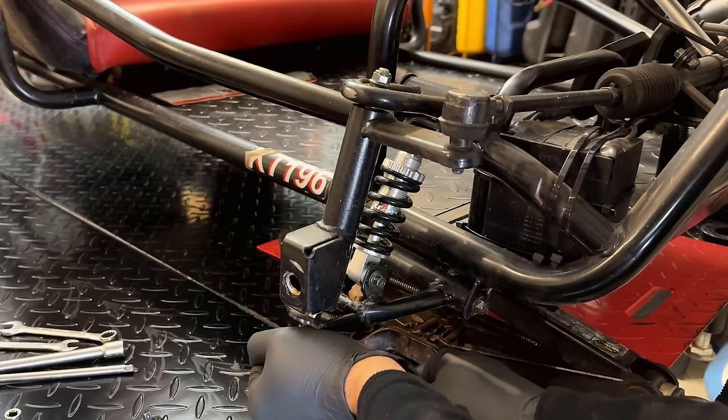I don't smell that smell anymore. And we'll just take a quick look with the thermal camera. Things seem to be pretty stable, if not a little cooler. It's about 140 degrees Fahrenheit. So I think it's just a combination of a new belt and maybe a little bit of chain oil getting on the belt. So yeah, I guess I'll keep the cover off for now and just keep an eye on it.